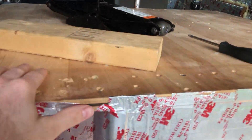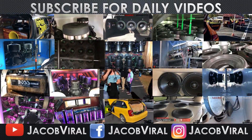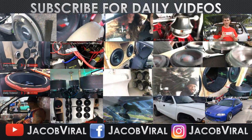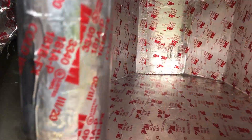Today I'm going to be doing a simple test with some bracing on the box. I want to see what it does with my output peak as well as my SPL decibels for my single 12. Currently with my box, I tried putting a brace on the inside and I lost — just a small half-inch or inch baffle brace in the middle. What's happening is up here it slightly bounces a little, so there's not a lot of sturdiness. I'm going to try it on the outside and I'm really curious to see what happens.